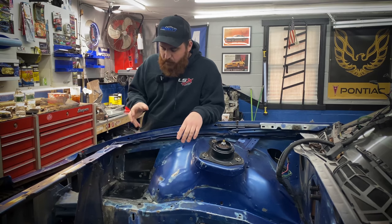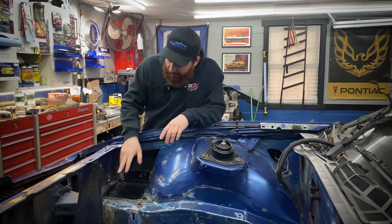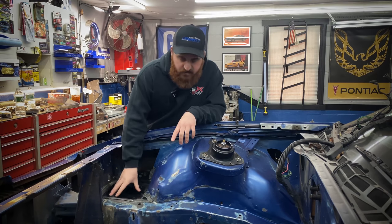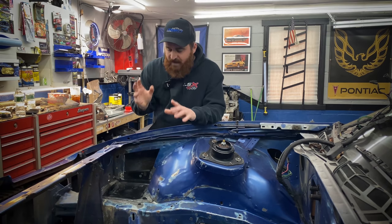Up. Battery tray is welded in. I just drilled some holes in the tray itself and basically just tack welded it the same way the factory did. I got my little patch panel installed here and everything looks pretty good. This is extremely secure. And I went around the bay with the wire brush on the grinder and cleaned up any substantial amounts of rust.